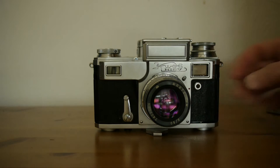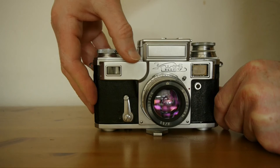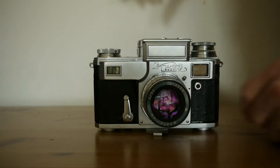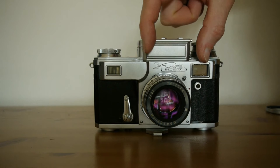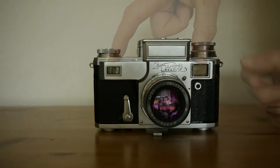Focusing on these cameras — you have to unlock it, and it works by this little wheel here. As you turn the wheel, there's an internal gearing system that drives the rotation of the lens. The Kievs have a long-base rangefinder. The Leica rangefinder has about this distance between the two windows, but the Kiev has almost twice as much space, so it's said to be more accurate.